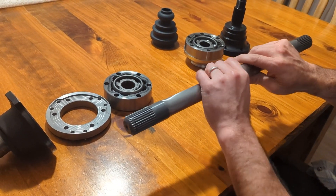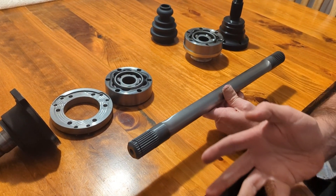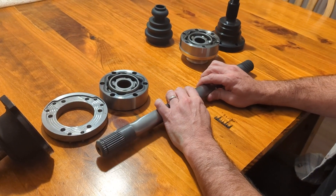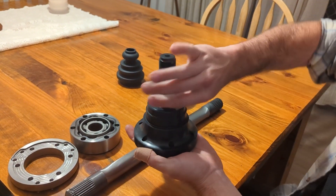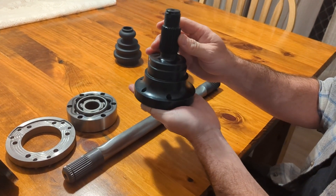That adapts the diff in the cradle we mount out to the standard BMW outer. But as you know, a lot of those still have a weak point at the outer CV cup and CV hardware. So what we've now done is started to make billet outer stubs — which you've seen in previous videos of our E30. This is our latest version for the E46.